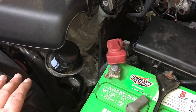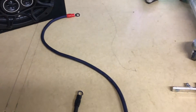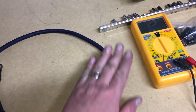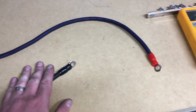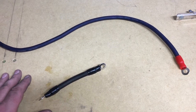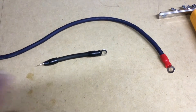We're not replacing the wire, we're just adding to it. What I've already started doing is prepping the wire. This will be our run between the alternator and the battery. This one will be from our battery negative to the ground itself, and I'm still putting together a run between our engine block and the body chassis negative — so one, two, and soon enough a third.